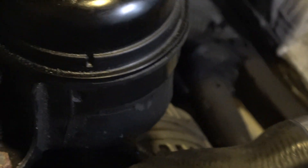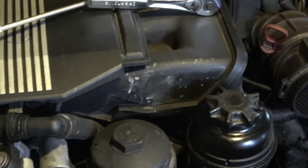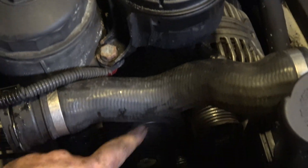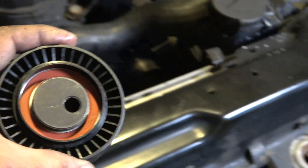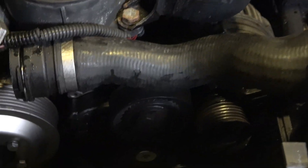I thought the whining sound was coming from my oil pump, but it wasn't — it was actually just a bearing that's out. It's not supposed to spin that hard or freely like that. So I got a new one. This is a good bearing, but it's not supposed to spin freely like that. I'm changing out my pulleys, including the bottom pulley down here.